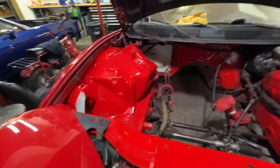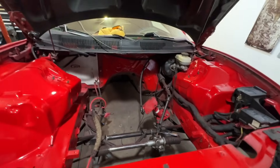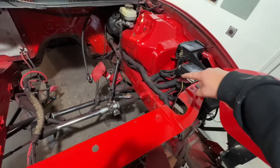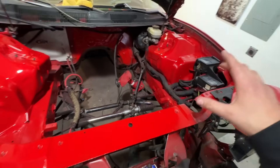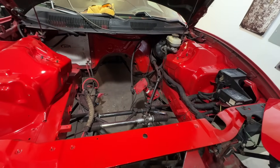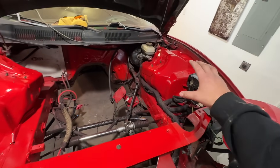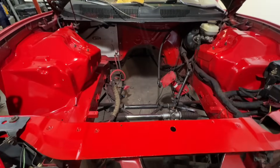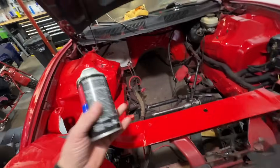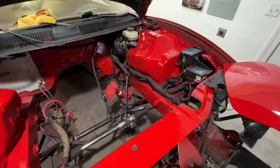Movie magic — it's more presentable. I finished that last clip and then just said screw it and stripped all the paint in the engine bay. I re-wrapped all the wiring harness, still have to pull this harness up and through, and reinstall the bumper. But the shock towers are painted, the back firewall is painted for the most part. All the fuse box wiring is tidied up, shock towers look great. I'm not a professional painter, but a good scuff, spray, good prep work, and your average Dupli-Color perfect match — for what I'm doing with this car, that's more than enough.